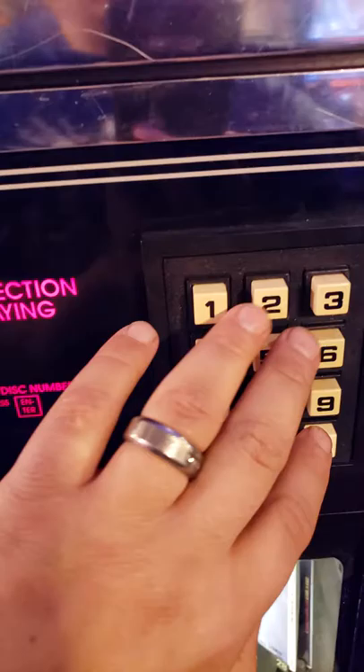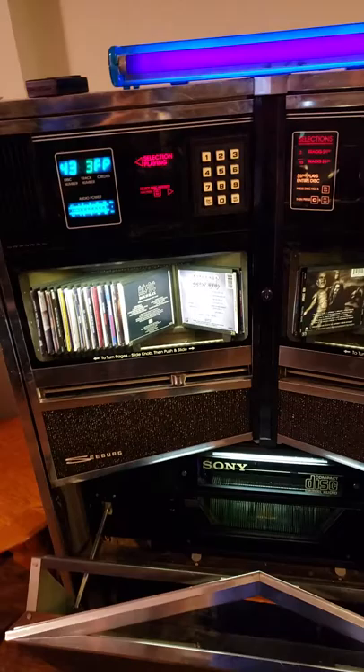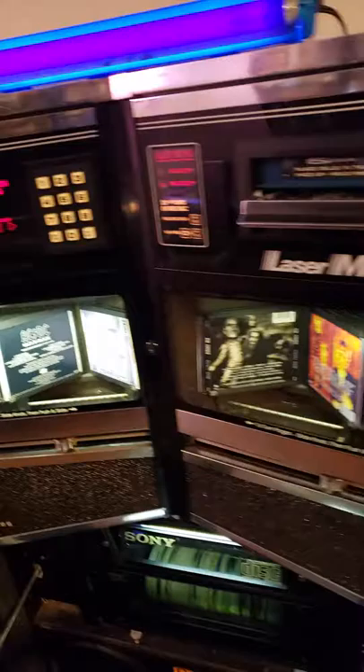Oh, when I got it, one of these buttons — I think the 5 button — was stuck. You couldn't push it, so I pulled this whole thing off and cleaned it. That got that working. The bill acceptor does work. There's a setting for free play — that's what FP stands for on the thing there. If you put it in pay-to-play mode, it scrolls 'insert coins or a dollar,' which, interestingly enough, there's no coin slot. There's a block-off plate where there'd be one, but you just put your dollar in and it actually dispenses down the side here into that box.